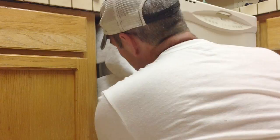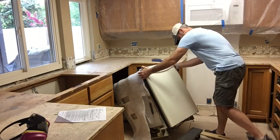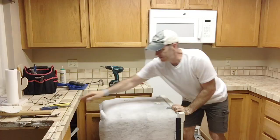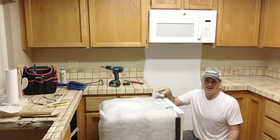Once you get the dishwasher out, it's now time to pull those lines through the back of your cabinets. If you get a dishwasher today you're just going to have those two tabs — definitely have something you can use to get them past the lip. There's always going to be a lip on a countertop whether it's tile or not. That's basically how you pull a dishwasher. Check out the rest of the demo to the right, and as always please subscribe to How2Q, like this video, and thanks for watching — see you next time on How2Q.